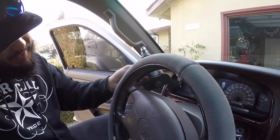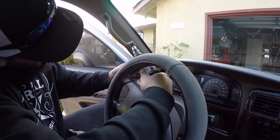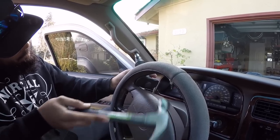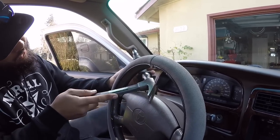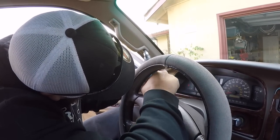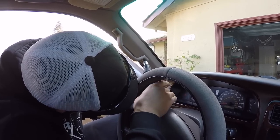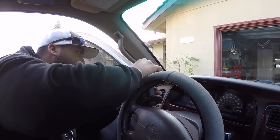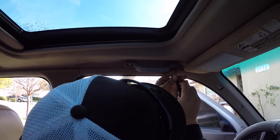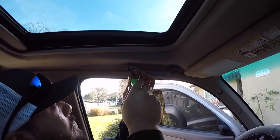The steering wheel gets in the way — this is going to be kind of tricky to strike between the steering wheel. It's finally loose. We're going to be able to get both A-pillar grab rails off without breaking or stripping anything, which is pretty good. Both grab rails are now out of the A-pillar. Now Mark's working on the driver's side grab handle up near the headliner — these don't have any factory Loctite, so these should come off just with a standard Phillips head screwdriver.